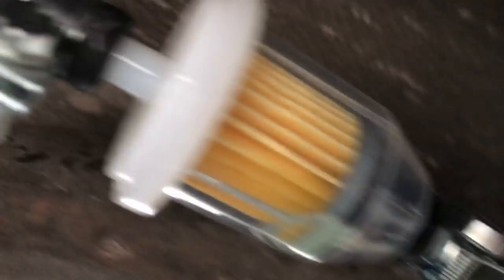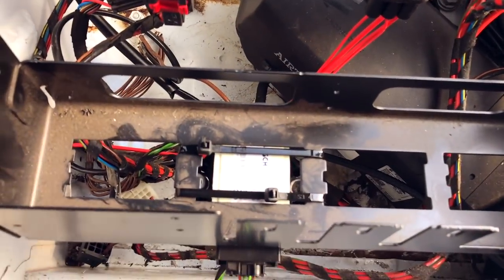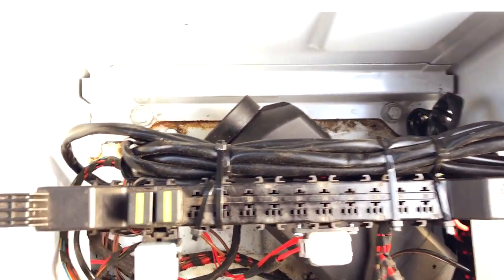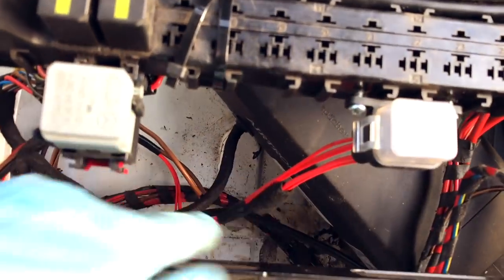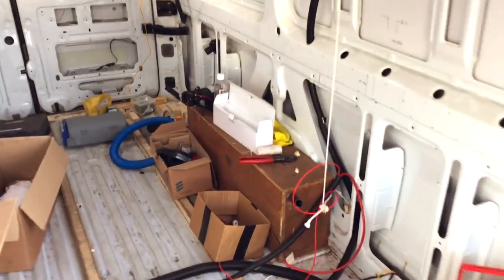It's coming - good stuff, it's going to work. All nice and neat - kind of. I think it's a crash sensor, just cabling that back on and tucked it down here with some other wires. I've wrapped these cables up rather than cutting and soldering them, just in case we take it out one day and put it in something else. These are the fuses here for the night heater. The live wire goes out here, through this little gap, down this conduit which goes down to the leisure batteries down by this wheel arch.